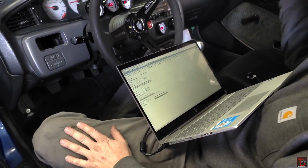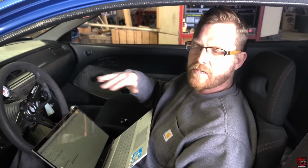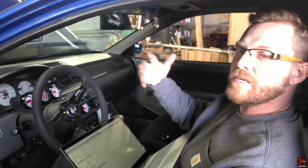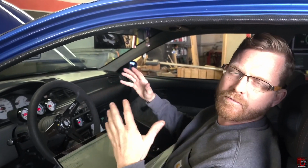I'm not going to go all the way out to 8,000 RPM, but we're going to tune it with VTEC off up until a significant 6,500 or something where we know we're not going to have VTEC that late. That way, if for some reason VTEC does not work, we still have the correct information under there and we don't have an unsafe condition.